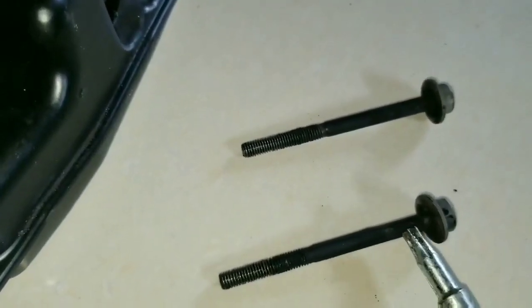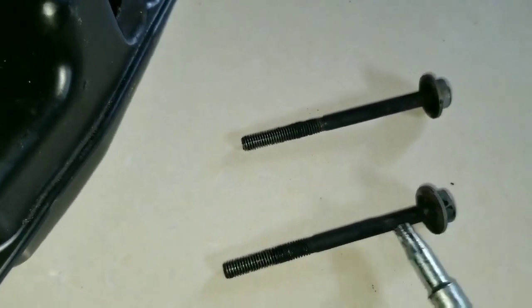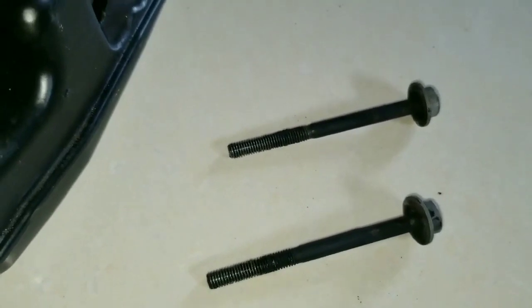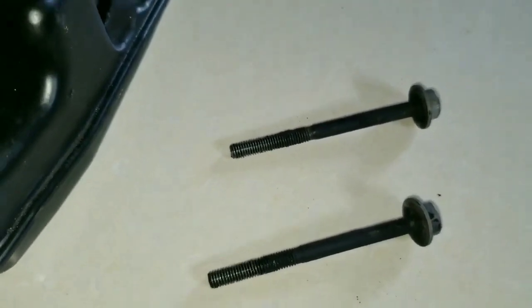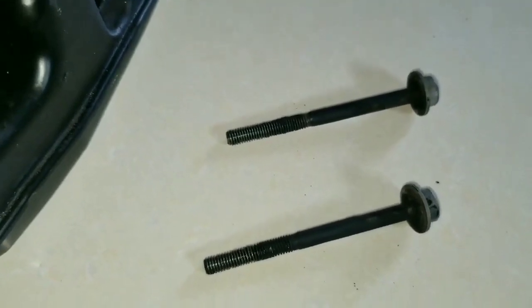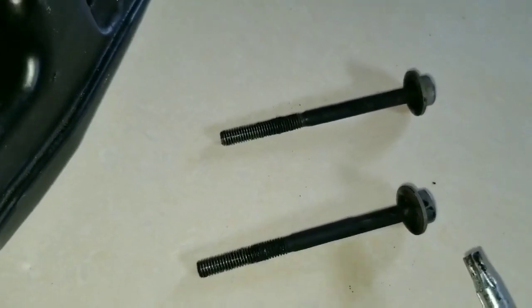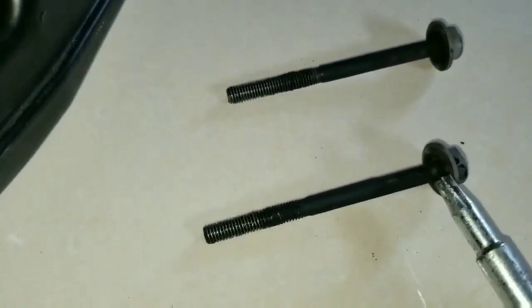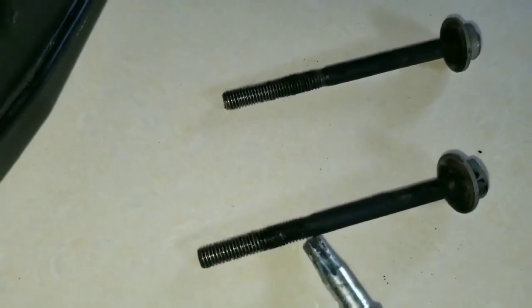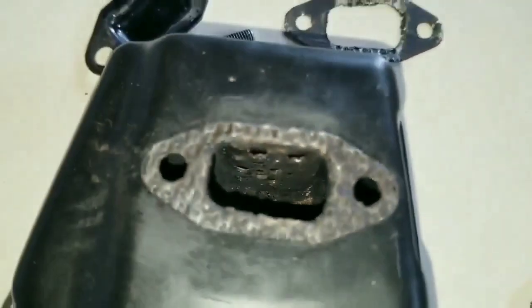Using a metal tube to sleeve the bolt inside of the muffler might be necessary if you choose to clamp the bolts and the muffler to the cylinder head like the factory recommends. That tube must be cut exactly to the length of the non-threaded section and placed into the muffler while the bolts are being passed through for fitting.